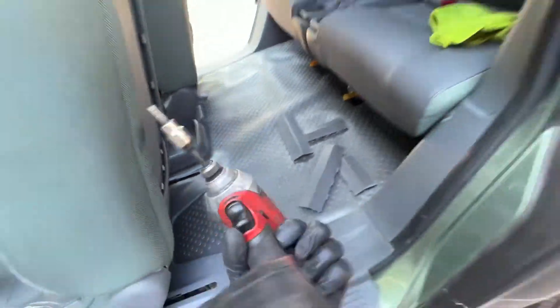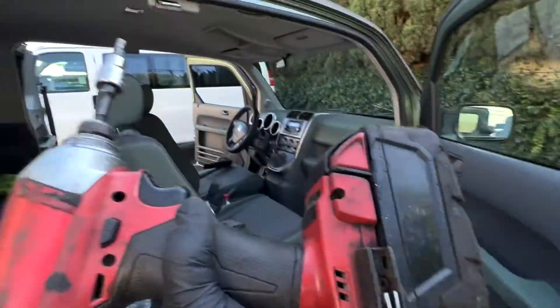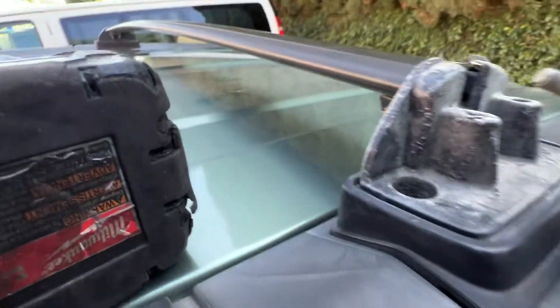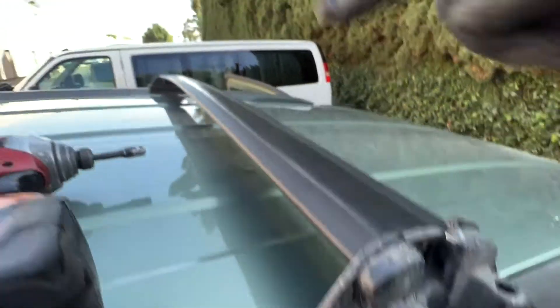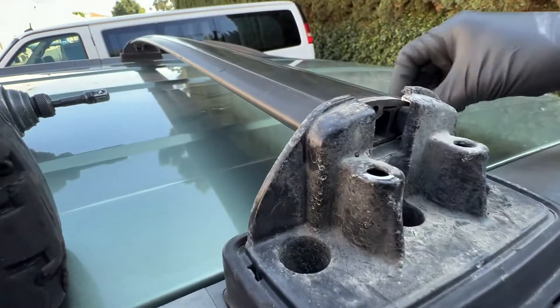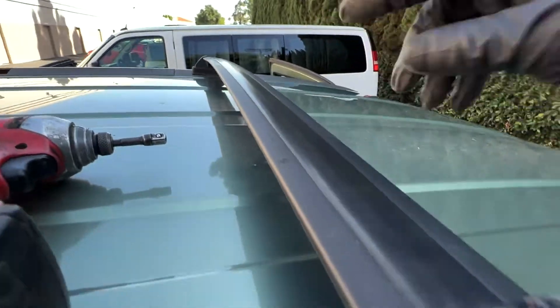Because you don't want to break these bolts — these allen bolts are very easy to break. Now let's go ahead and install it. There it is, all aligned, all perfect. We are just going to install this with the washers — install the bolt like this and this is going to be quick. Highly recommend you go by hand first — install all six of them, three over here and three over there by hand, before you tighten. Before fully tightening these three bolts, I highly recommend you do the other three first.